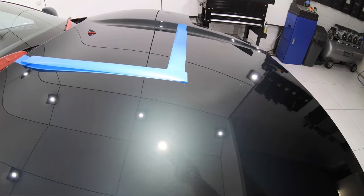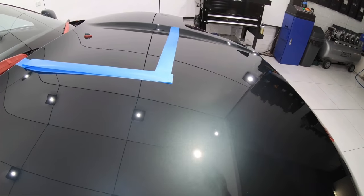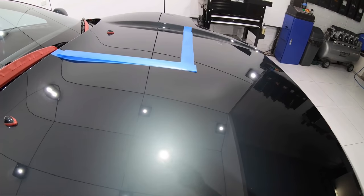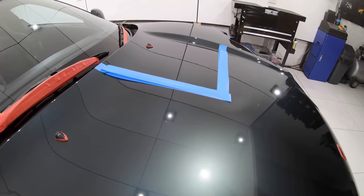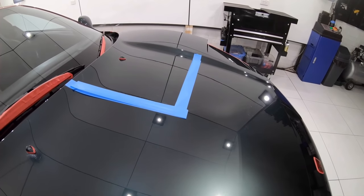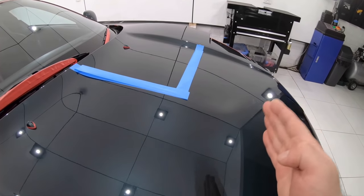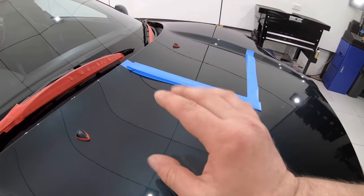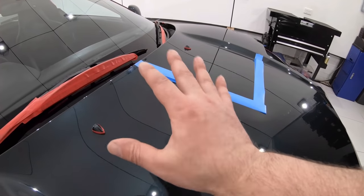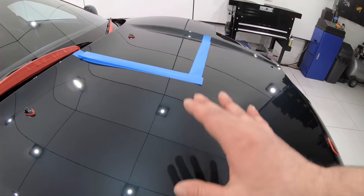My goal, and any detailer's goal in relation to paint correction, is, and should be, to try and find a single stage combination that both cuts and finishes perfectly. And although in many cases this just isn't possible, I'm personally finding that with today's fantastic compounds, pads and machines matched to a good technique, I can single stage more and more paints to perfection that just wasn't possible to do as little as 5 to 10 years ago.